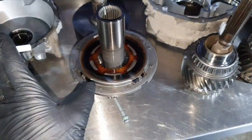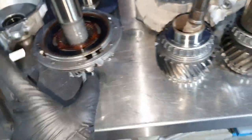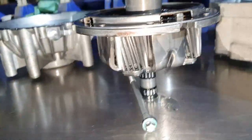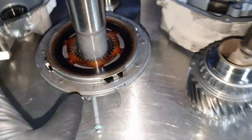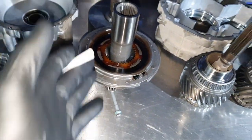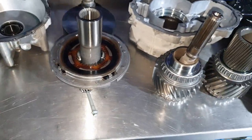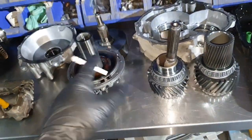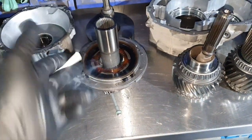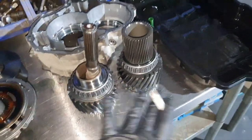This is for the 4matic. To change these clutches, you have to change all this piece, complete, the planetary gear. It's attached, it has the rivets. I don't know if anybody changed it, or put bolts, or you're going to rivet again. I have no clue. I don't even know where to find this clutch that has here. So the bearing, the race over there, the bearings here, all look good. There is no problem whatsoever.